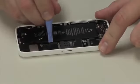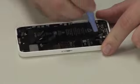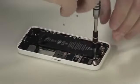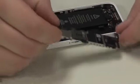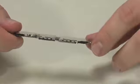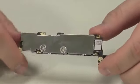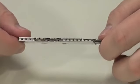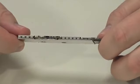Now with the battery safely disconnected, I'm going to detach the remaining main board connectors, remove several screws and standoffs, and finally lift out the board. Unfortunately, like the boards in the 5 and 5S, the EMI/RFI shields are soldered in place. As I want to put this phone back together in working order, I'll need to leave the shields alone.